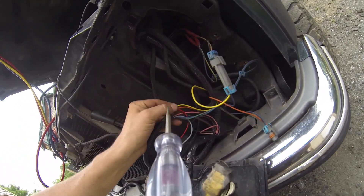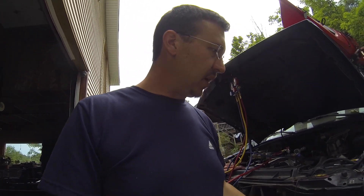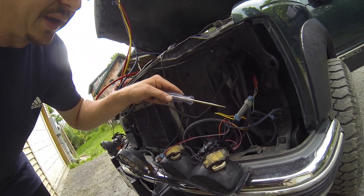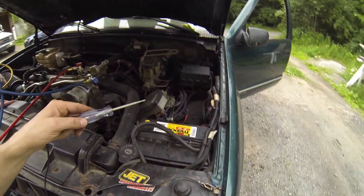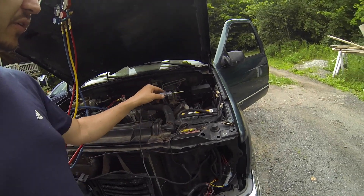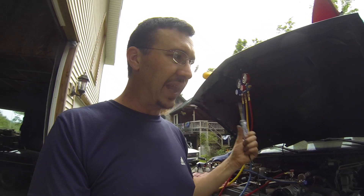Part of troubleshooting wiring is understanding what it's doing. Power is coming from the car into the harness via the yellow wire, and the yellow wire goes all the way back to the computer. The computer needs to know when the headlights are on so it can turn the plow headlights on — if a plow is connected, send power to the plow lights.